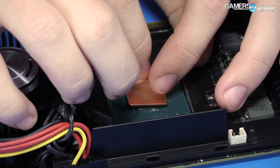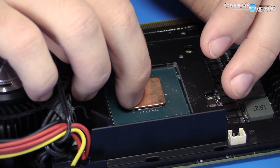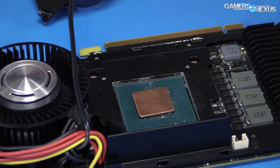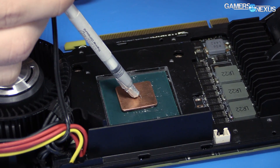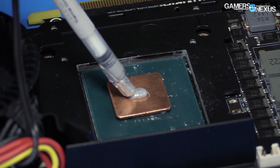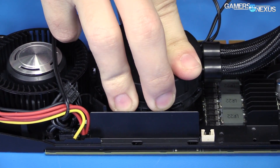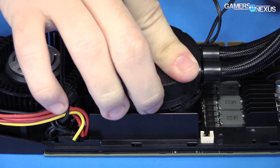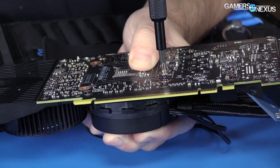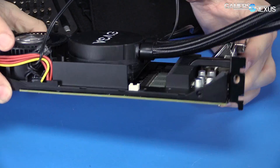We'll put it on the cold plate. It seems like it's got a pretty good hold. In a perfect world you'd have perfectly flat surfaces of copper, and in such an environment it would actually be worse to use thermal paste. Basically there are microscopic imperfections in the surface, and those are filled with thermal paste, which eliminates air pockets.